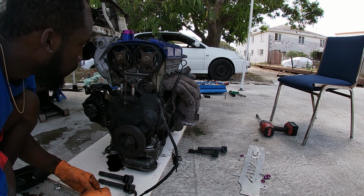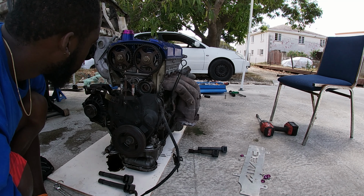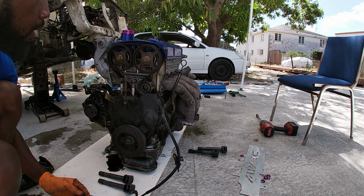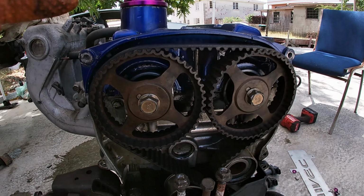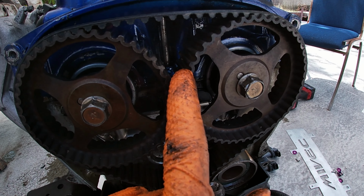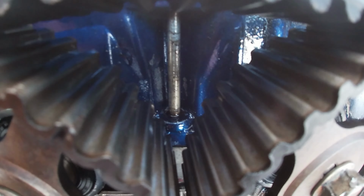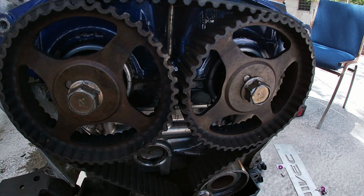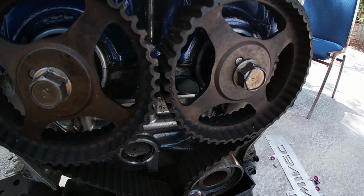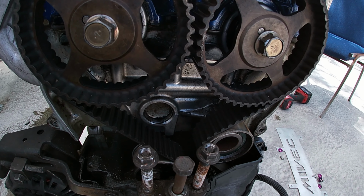One thing I was a little frightened of. Okay, I see where the oil leak is coming from. That's where it's gotta be, for real. I am convinced. This bolt here, right, that bolt there, I feel it might be damaging the valve cover gasket in this area. And then oil would be leaking from the valve cover, running down, and coming down at the front of the engine.